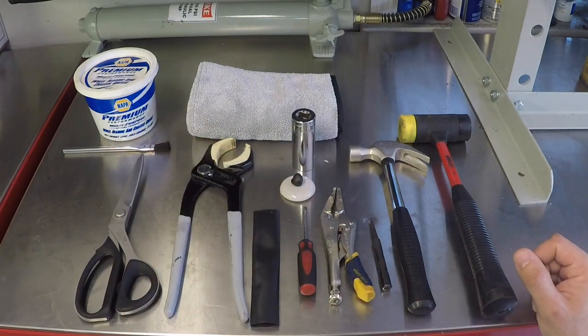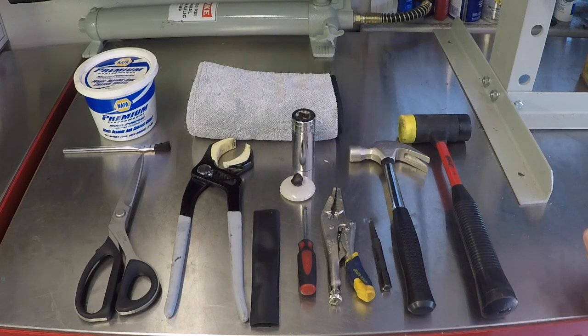The only tool not shown here is the heat gun, and I recommend this to anyone no matter what you're doing on the interior of a car — if you're removing any kind of panels or trim, make it a habit to use the heat gun. Because if you start prying, you're going to break stuff, cut your hands, get hurt, get frustrated. I've been doing this for a really long time, over 25 years, and the heat gun will be an indispensable tool no matter what you're removing from the interior of a car.